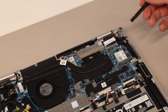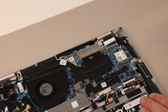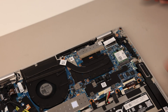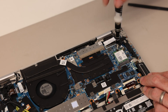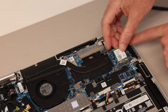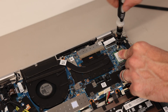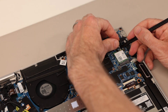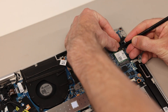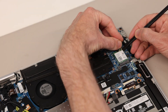The Wi-Fi card in this system is an Intel AX211, and there is a possibility that they implement a block list in the BIOS so that you can only use certified Wi-Fi cards — if you have tried another and it's worked, let me know in the comments. To replace the Wi-Fi card, first we're going to release the two antennas, then use our screwdriver to undo the single mounting screw, and like the SSD we can just slide that out. To replace, we reinsert, press down, and screw into place. The antennas are labeled, so number two is for the AUX and the main is labeled on the Wi-Fi card itself — align the connector and clip it down into place on each side.